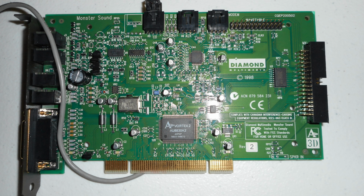And we need a sound card, and there are lots of options. Now this motherboard has ISA slots, so you can go with an ISA card. However, the focus here is really on high performance, mostly Windows 98 games, so I went with a PCI sound card. However, this card is actually really compatible with DOS as well, so you can still play your old DOS games, and especially the late DOS games are highly compatible with PCI sound cards. It's just those really old games like from Sierra or LucasArts where you run into issues with PCI cards. But all the games you see later in the benchmark, the DOS mode of this card works really well.